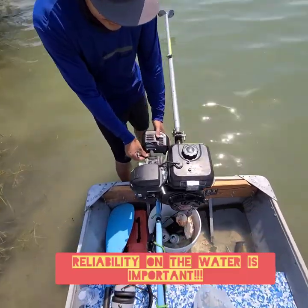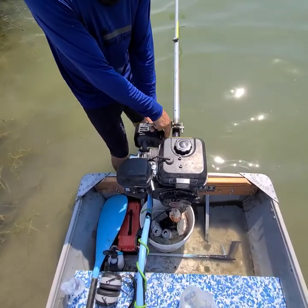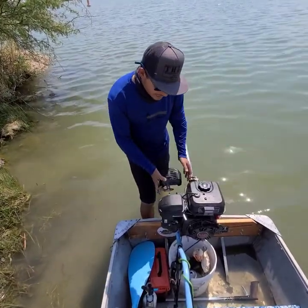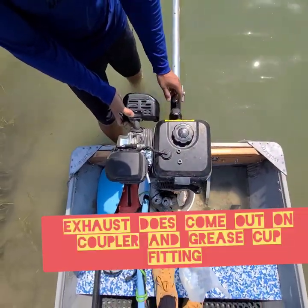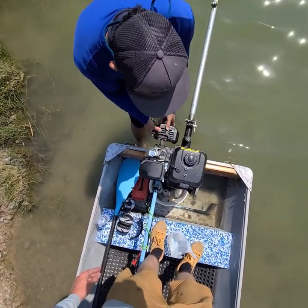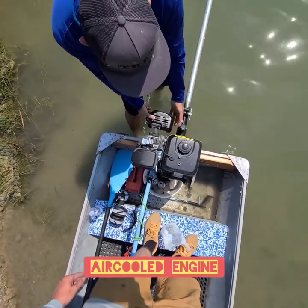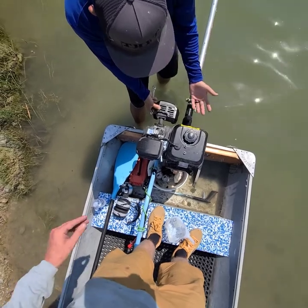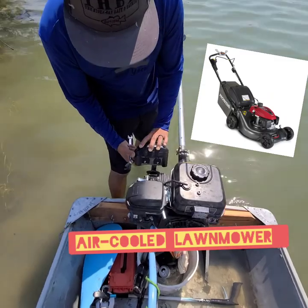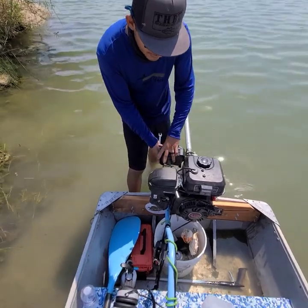I do like the setup where it's bolted down here, away from the exhaust. The exhaust does push towards the grease fitting, so the exhaust exits towards the grease fitting, but I haven't seen it being too hot to be an issue. You can see how it's now a horizontal kick out — the exhaust heat on this back side. When we're driving, the airflow is going through the motor and then exiting and cooling off the muffler. Any flow is going off this, and all the residual heat is coming off the back. That's the benefit of having it positioned back here — all the heat stays in this area rather than being directed back toward the engine. So that's what we're testing out.